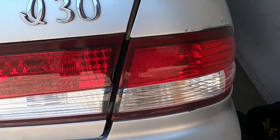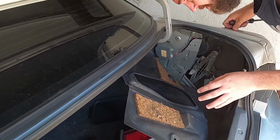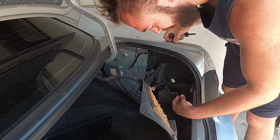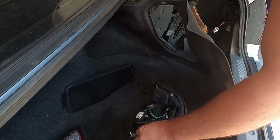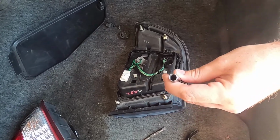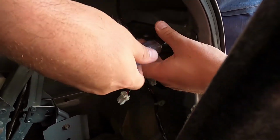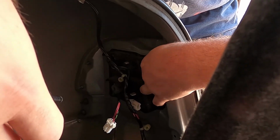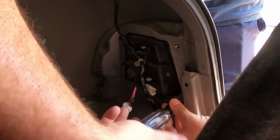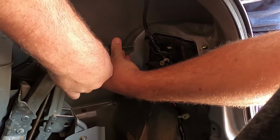Also, this sucks. Okay, super easy. I'm sure everybody's done it before. You just undo the plug. These two just kind of self-lock onto the studs of the taillight, and then you got 4 nuts. And if you use a screw stick, which I love these Husky ones, the bigger end, I think it's 1/4, that just slips right over, and you pop the nuts off. And then I like to finish with my hand. That sounds bad. Just so that I don't drop the nut. Oh, the jack. It's almost in the way.